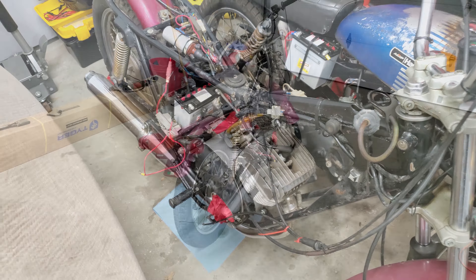Cover is back on, kickstart is back on and recoils as it should. It's really hard to crank over by hand. We have our spark tester in there — going to kick it over to test spark. After that I think I'll leave off for tonight and come back tomorrow to pull the carb, clean out the gas tank, and put in some 50:1 fresh mix. I hate dealing with spark stuff so I really hope it's okay. The previous owner claims he had it running, so maybe we have spark — he did set it at a high idle though, which is why I want to go through that carb.